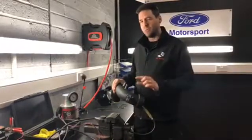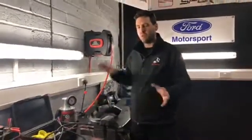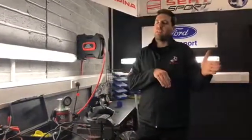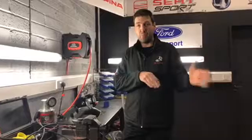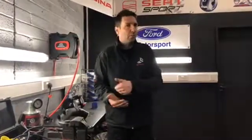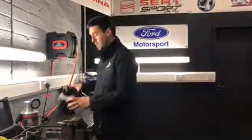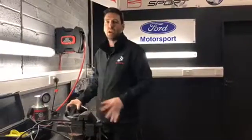If there's a small amount of leak, each ECU has a small amount of tolerance, so if it achieves 1.3 bar, it might not necessarily flag an engine management problem. But when you're tuning, and let's say we ask for 1.8 bar but it only hits 1.4 bar, that's when you can get engine management lights and problems, because the whole induction system has to be tight and solid.